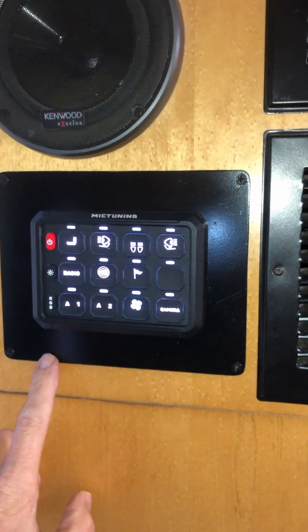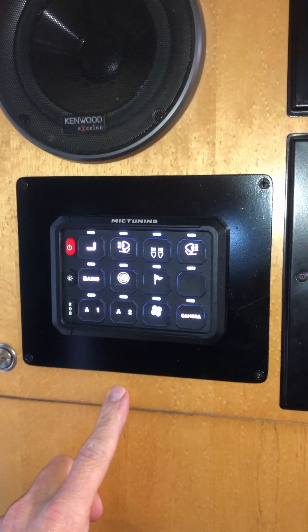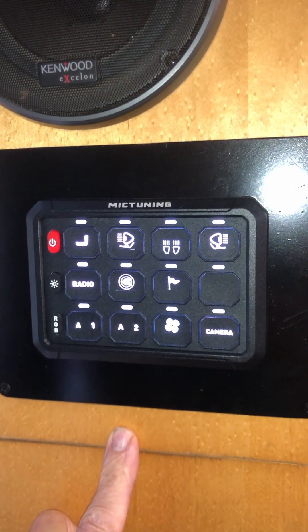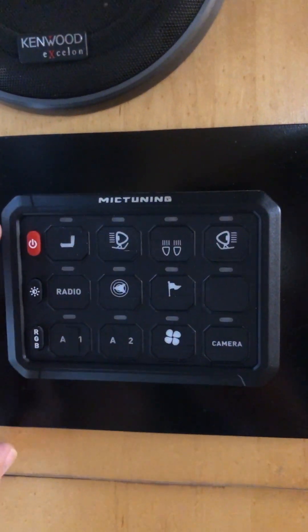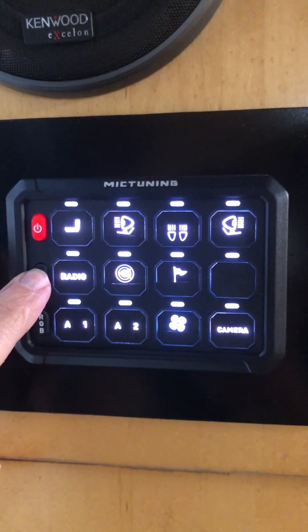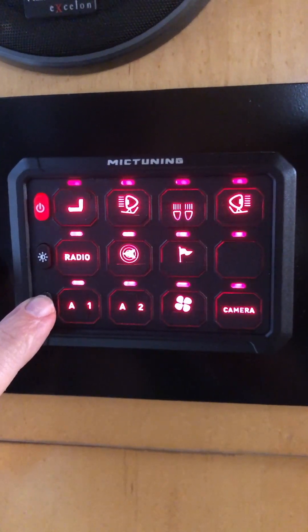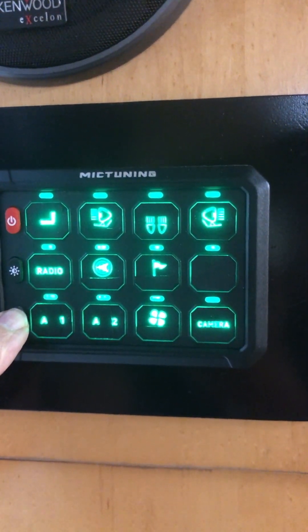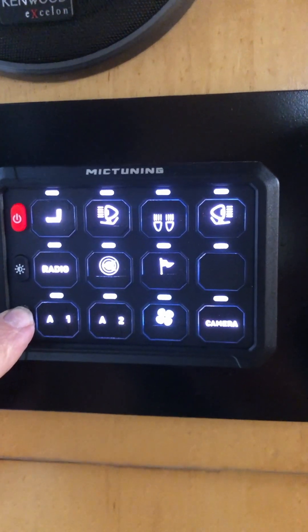Just took a blanking plate, made this out of aluminum, spray painted it black, and used it to cover up all the old ugly holes from the plastic manual switches, and put this pretty cool little panel. It's got 12 individual functions on it. You can program it for toggle on and off or momentary contact on and off. We have an on/off button here, brightness control — which my wife's pretty happy about — and you can change the colors: red, orangish, yellow, green, blue or cyan, dark blue, pink, back to white. We'll probably leave it at white.